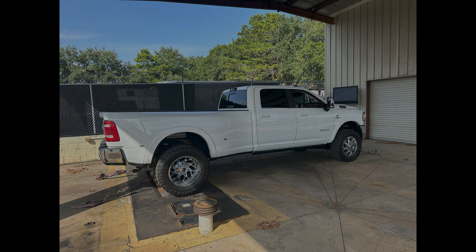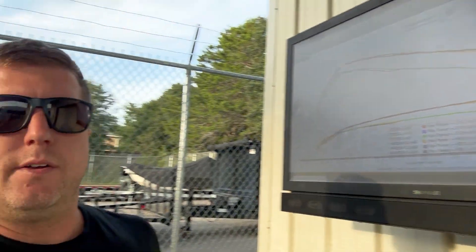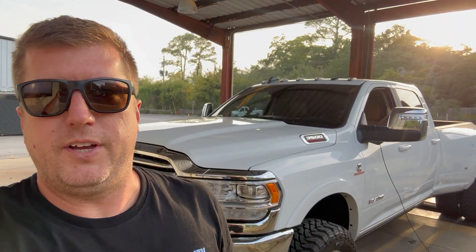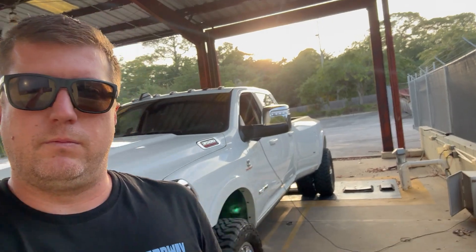That's a wrap for us. The 2024 truck's all done. We got 75 horsepower and about 100 foot-pounds of torque out of the deal. We don't really have enough PIDs on the data logger set up yet to continue to push any further. We also don't have the shift-on-the-fly operating system yet, so we're happy with that — nice little gains. As far as I know, it's the first 2024 to be tuned with HP Tuners, according to HP Tuners themselves. We'll have this truck back in a few weeks to upgrade the shift-on-the-fly and really push for some more power. This truck was about 25 horsepower down because of the wheels and tires — the big old mud grapplers, duallys, all that stuff. My similar truck made 526, 525 horsepower, so I'd expect this one to be right about 500 all said and done.